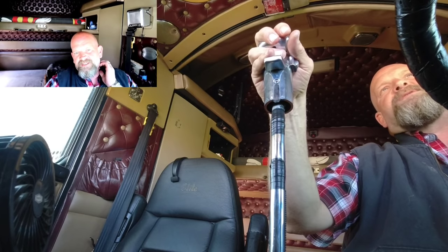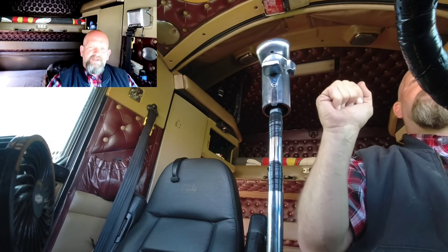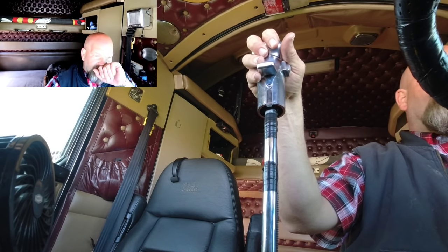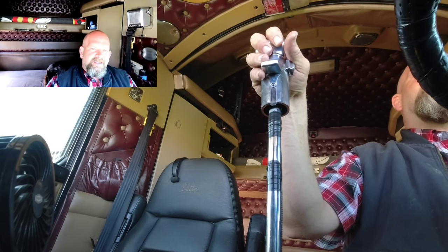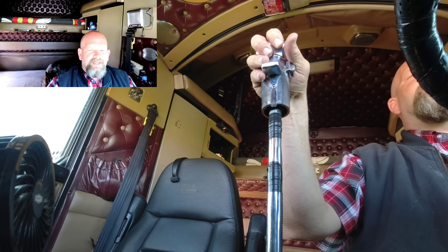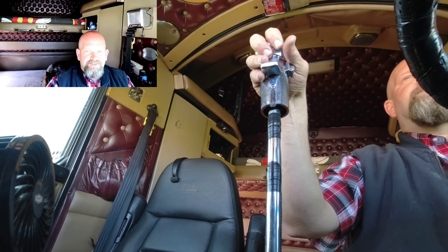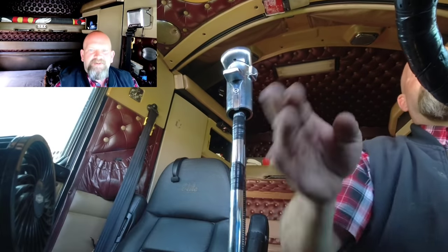One thing you guys are gonna recognize is when I go through my gears, once I get to the high side, I usually put it in gear, pull it out of gear, split the gear, and then put it back in here. You're gonna wonder why I do that. I was taught that many, many years ago when I was shifting. In my head, I kind of believe it actually helps things, but usually you can just let off the accelerator and then push back on the accelerator, and it will shift into the next gear after you split it. Sometimes it won't though, so that can get kind of annoying. So I just always do it this way. So just to answer that question, it is not needed. You do not have to do it, but it's just a plus.